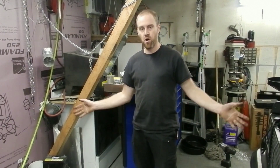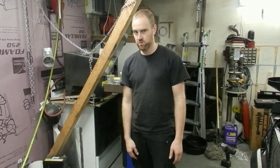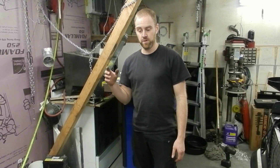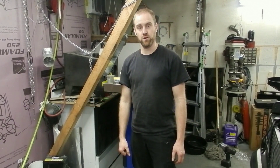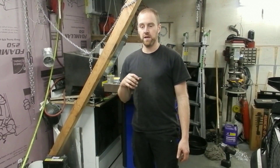Transmission jack stand. If you have a limited shop like I do — I'm small, I have very little room in here — my engine stand takes a lot of space, but it collapses. If I were to have a jack stand as well, it would take up far too much floor space. You can take your cherry picker, your engine puller, and turn it into a jack for a transmission. With a little bit of leverage and ingenuity, it works awesome. I actually prefer that over a regular transmission jack, because I can straddle the hoist so it's not causing an issue. It works phenomenally.